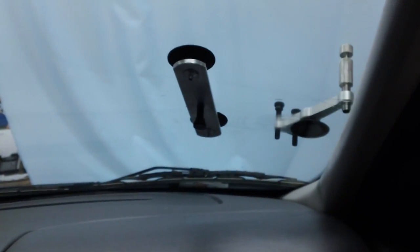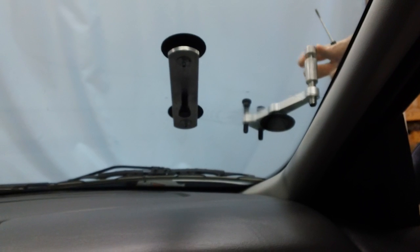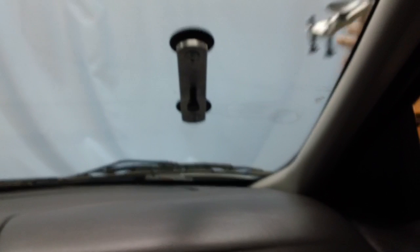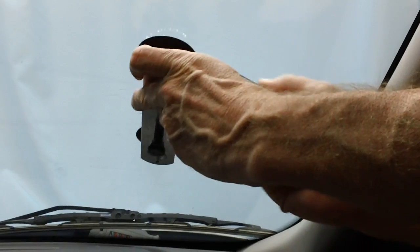Slide off the crack and do a little quarter-half turn of your injector so the resin doesn't spill on the windshield. Loosen your crack opener. Never cure with your crack opener on, because the resin will cure and then when you take the crack opener off, because the glass wasn't in its neutral position, you will end up refracting the resin.